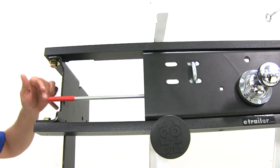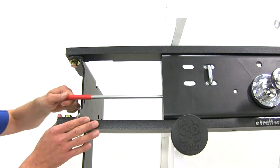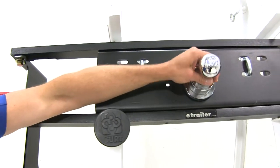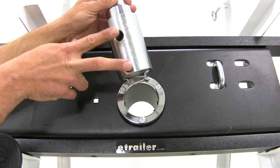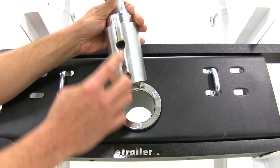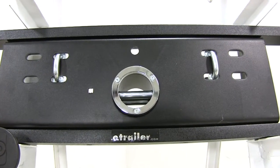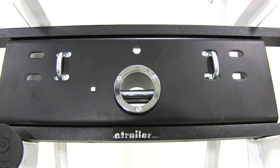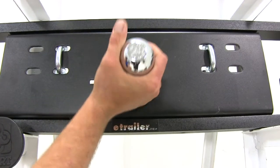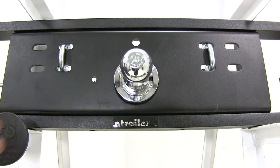The Curt's handle is about medium length, right in between the Draw-Tite and the B&W. It works like the B&W: pull out and rotate clockwise to lock it open, allowing you to take out the ball. A key difference is that the Curt has dual pins — two five-eighths inch pins that come through. There's a groove on the side and it can only slide in one way. The dual pins pass all the way through and engage both sides of the head, giving great holding power. With the ball engaged, there's noticeably less movement than on the other two.